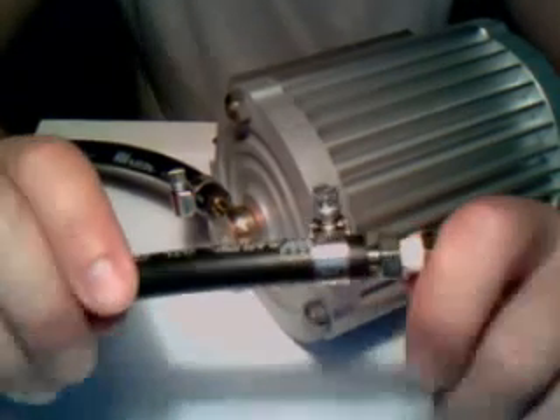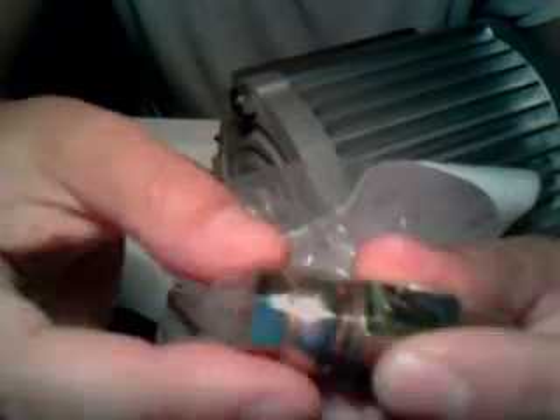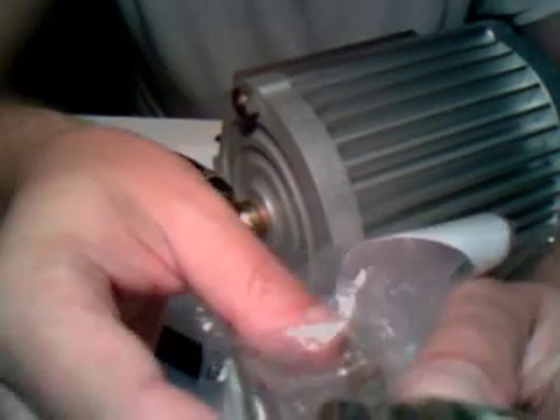If you don't want to feed to the valve cap because it's plastic or for any other reason, inquire whether you can get a special screw for the oil sump. We have this, for example, for the Mercedes G-model or other Mercedes models. This is an M14 thread which goes into the oil release screw position of the oil sump. It has the same ring fitting and hollow screw as before, and you can attach either a Teflon hose or the standard rubber hose as you prefer.